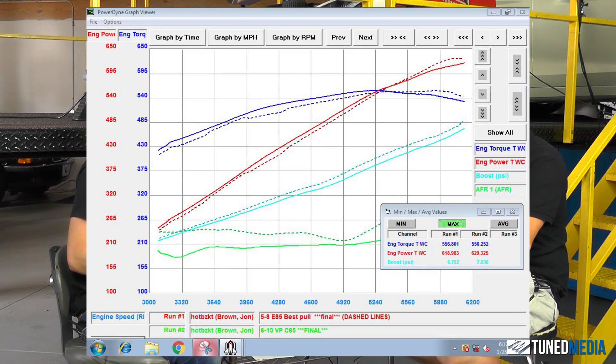Our C85 slash C40 is better, and it is the new champion — the horsepower king so far. The horsepower is higher, the torque is the same, so the dyno charts show the gains were really just in the higher RPM range. If you're drag strip oriented and you're full throttle hitting a shift point over 5,000 RPM or whatever, that's definitely going to be a better fuel — you're going to go faster.